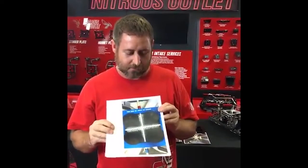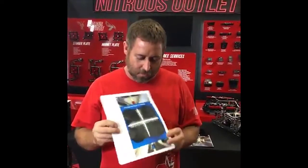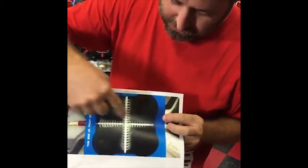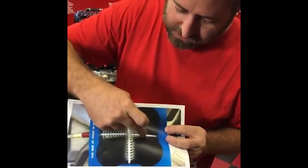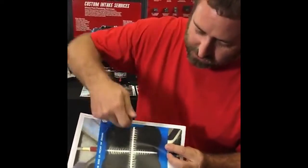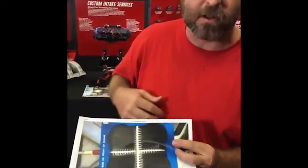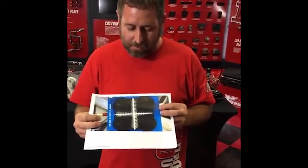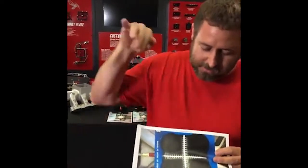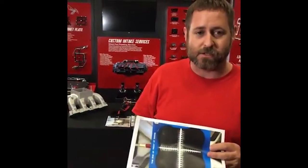Here's a common dual-entry cross-bar plate that many of you are familiar with — many manufacturers make it. Look at the Christmas tree effect: it's entering this end, spraying soft here, heavy on the opposite side, and it's aimed down toward the intake runners. The other side is doing the same thing. As you change your horsepower levels, it moves around, but it still does the same thing. So if you're putting a lot of nitrous in the motor and you pedal the car, you change the airflow characteristics going into the intake — the air pulses — and you've tuned according to wide-open throttle. That's why you killed a cylinder.